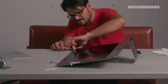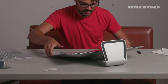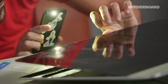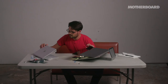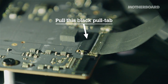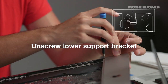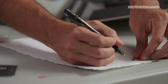I'm going to pull out my phone and just light the inside. There are two wires in here that I want to disconnect that are connected to the logic board. The first one just pulls out against the connector — one is disconnected. If you're following along at home, this is around step 20. There's another cable that you need to flip something up before you pull it out. I was a little scared to be rough with it — I just wasn't pulling hard enough. I'm going to take these five screws out, drawing a little box and putting them in so I know they go together.